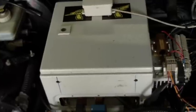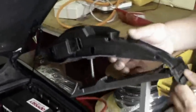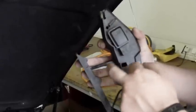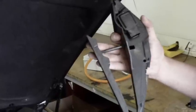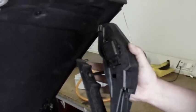So what I'm going to try to do today is to take all of that out and put this new pedal in, because this has two Hall Effect sensors that basically activate from some kind of a cam setup inside. I'm going to get a hammer and tear out that throttle pedal and see if we can get this to fit.